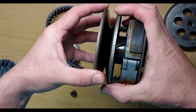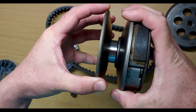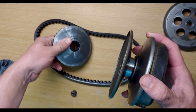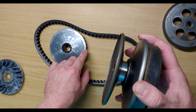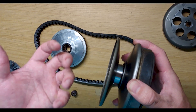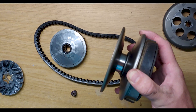As the rollers impart force onto the variator, it pulls this section down — that's second gear, where your belt is going to be at the very bottom of the torque driver and the very top of the variator. You can see that wear mark there — that's second gear — and in between is where you'd normally ride the bike. In essence, the CVT works by imparting forces across rollers, belts, and spring tension at the rear.